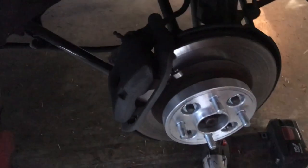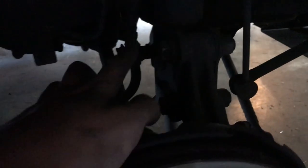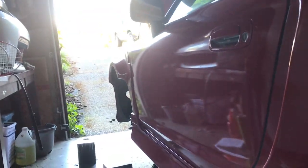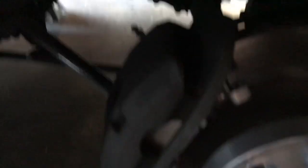Alright guys, for the rear one — sorry, the lighting is really bad — just swing it up. There's a 12 millimeter right back here; take it out. It has a couple of washers on it. Then you take off the little spring and bolt that goes through the part where the e-brake cable is. I took it off because you need to swing it up — this piece is all one mechanism. Then remove the other 12 millimeter for the line. You do need to take that brake line off with the 12 millimeter.